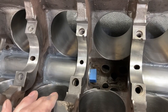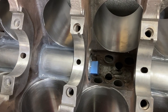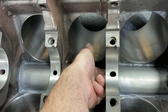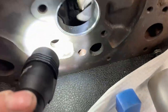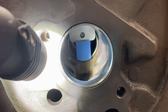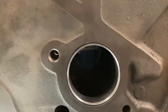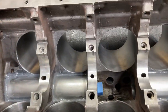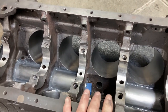It's very easy to install. The biggest issue is that any casting flash down here in this area needs to be smoothed out — that probably should be done anyway. That lets these pieces rotate freely so you can get them straight. I'll move another support block over to this side and lay this one in. The good thing is you can access all of this from inside the cam tunnel. I can take something and knock those plastic support blocks out, which lets the aluminum support fall. Then you just play a game of operation with a long set of needle nose pliers and you're done. Props to Mr. Barrett for nailing all this.